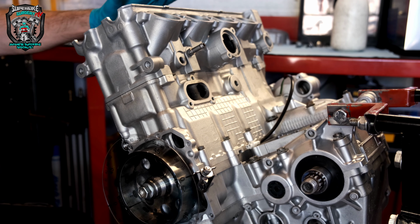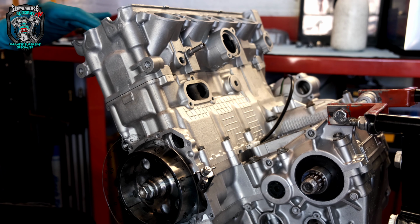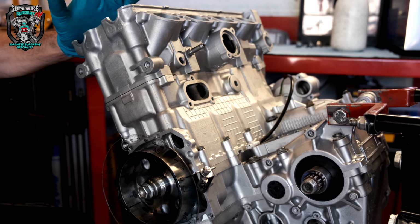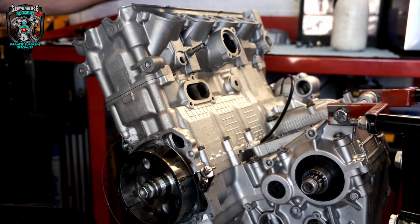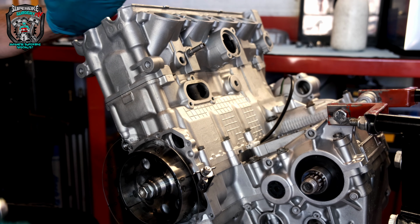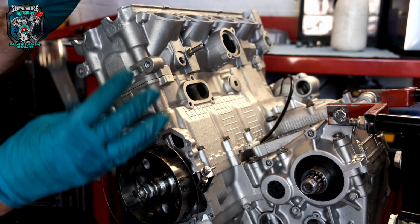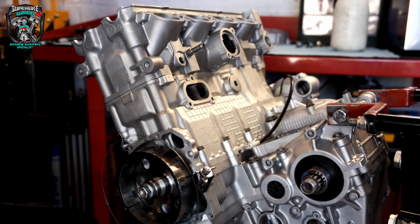Right, camshaft's in. I'll probably time lapse this. I'm going to pop the cams in, cam chain tensioner in, and then although I know the valve clearances are all good because I did them on the bench, I always, just because I like to sleep at night, recheck all the valve clearances. We'll put the cam cover on with a new cam cover gasket, and then she's ready to go in the frame. Oh, and the generator cover, put the generator cover on then. Oh, there's a little covery thing there as well, the water pump. I'll leave all that stuff off till it's in the frame. It's easy to do when it's in the frame. Not that it makes it lighter, but the smaller the lump, it's easier to manipulate into the frame rather than having the water pump in the way. Anyway, time lapse of cams going in, and then it's time to put it in the frame. Happy days.